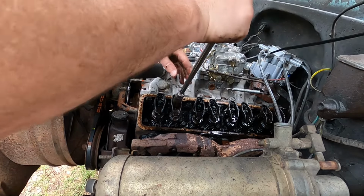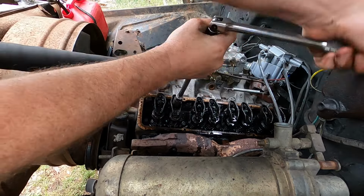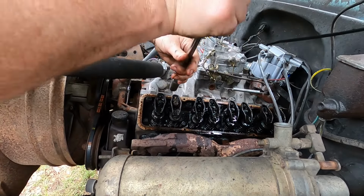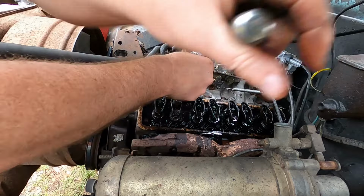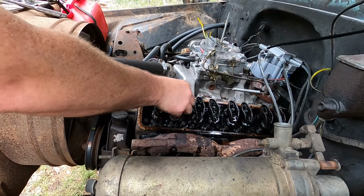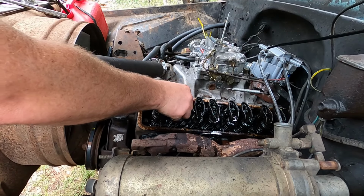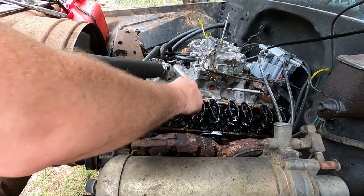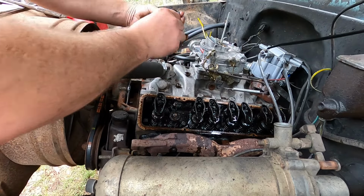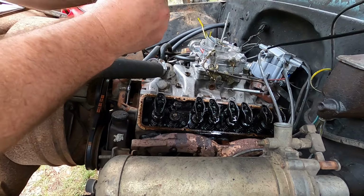I blew air through that push rod, but who knows, right? I'm gonna take it all the way off, and I'm gonna go ahead and blow that brake cleaner through there, because there might be a little hunk of junk that gets stuck in there, and we'll see what happens. This is still perfectly clean, so I'm not gonna mess with that.